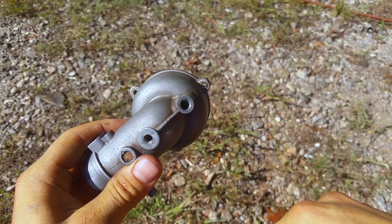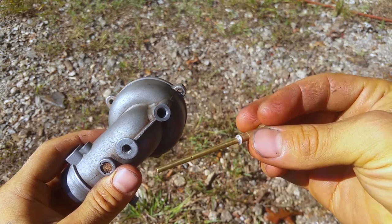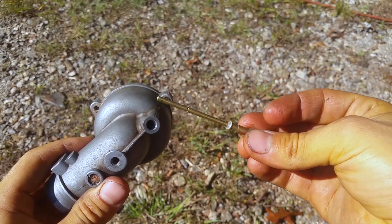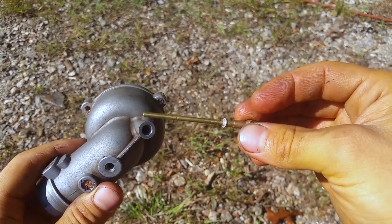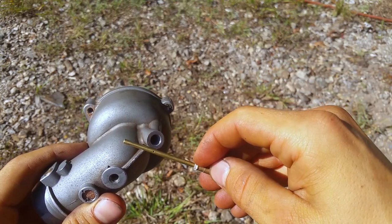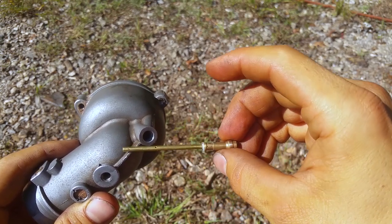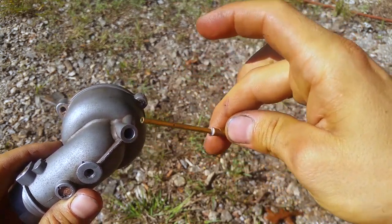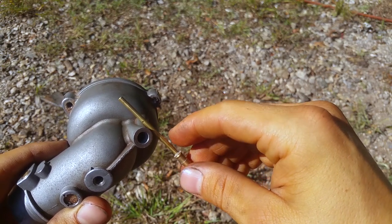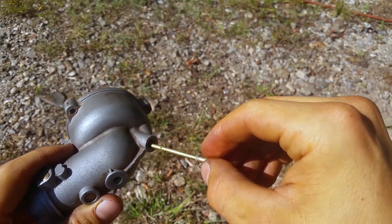All right, so here's the last tip I want to give y'all when working on these carbs. You can see I have the emulsion tube out here, and these have a problem with leaking. So it's another leaking problem, and this problem is so annoying, you're going to want to do this to fix it. Right here you see it has a Teflon sealing washer on here, and it's paper thin, like parchment paper thin, and there was a Briggs service bulletin PDF. I'll put a link in the description where y'all can find it. It has part numbers for these little sealing washers, and what you do is you get one and you put it on there, and when you thread it in here, it seals.